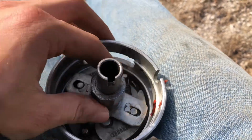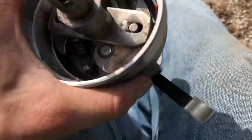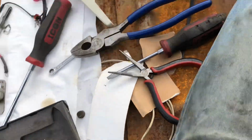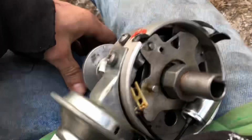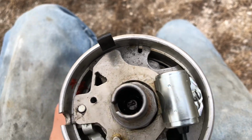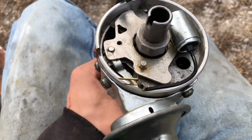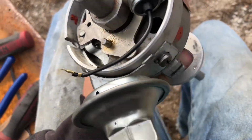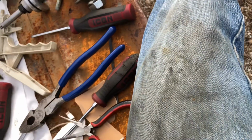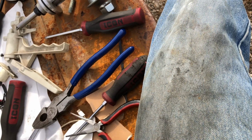Alright, I'm going to take care of that and let my phone charge for a little bit. I'll get back to you whenever I get started putting this together. Everything comes freely. I'm going to double check the vacuum, put it back in and retime it back to where it was. Maybe give it a little bit of hair more, because I'm pretty sure I set it at 18, 19. It was at 15. I may just go ahead and set it at 17, meet in the middle.